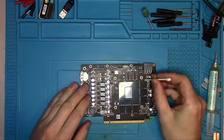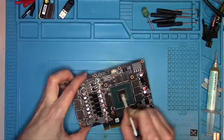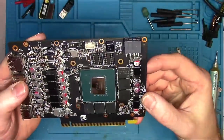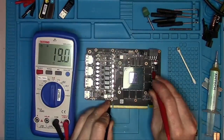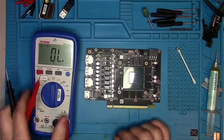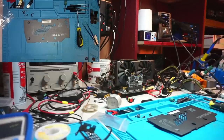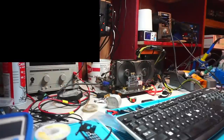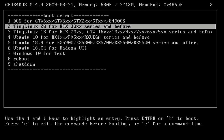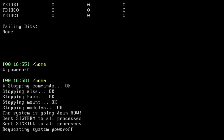Card cooled down. I'll do a little bit of cleaning so it looks good, and then we double check the resistances, which at this moment are reading even lower than before, but that's only because the card is still a little bit warm. Then I partially assembled the card and ran the memory test one more time. Test was completed, no errors were found, and that's great news.